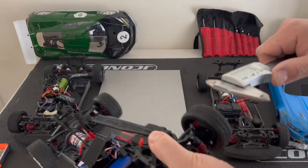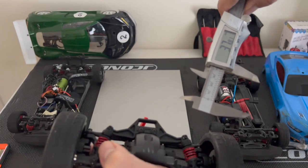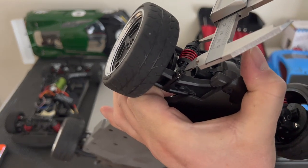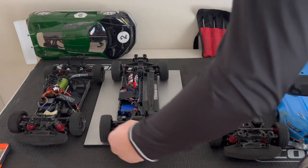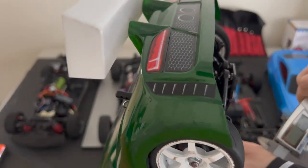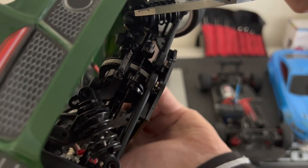These shocks measure about 37.8 to 38mm top-to-top of the screw. The 2.0 shocks measure about 41.6mm bottom-to-bottom — so about three and a half millimeters longer. You could use a shorter body shock, or limit the shaft internally with nylon washers — I believe these use 632-size hardware. This is an X-Ray, but Yokomo is less expensive; I'd get those parts. The ball is about 5.9mm and it uses a 3mm screw to hold them in.